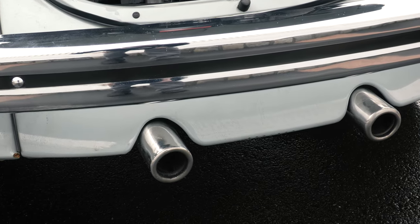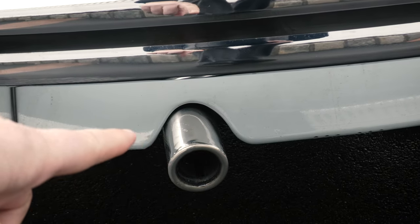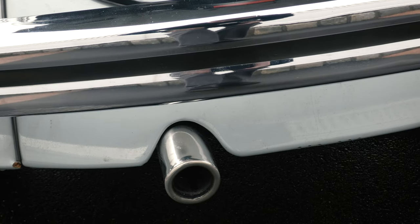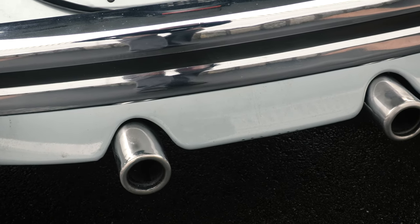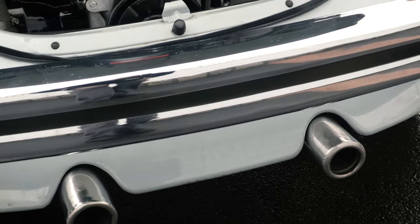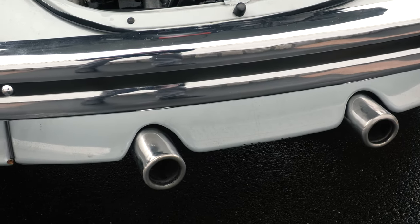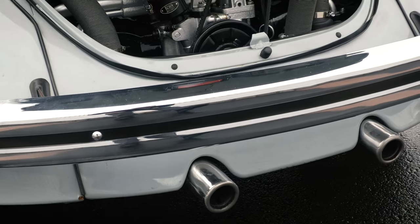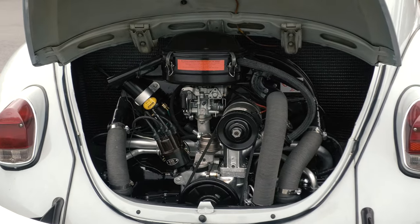The exhaust was a little off when we got it. When we put it on the engine, the exhaust tips were actually touching the apron, so we didn't want to run the car with the exhaust touching the apron. I called CIP1 about this and he said they're almost always off a bit. I asked him what the solution was and he said you've got to improvise. So we actually had to cut the pipes, move them a little bit, and then re-weld them to get them off the apron.